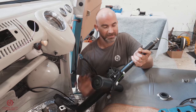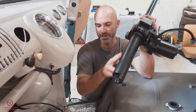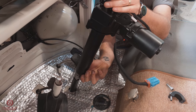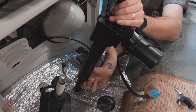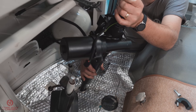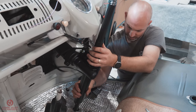And when it comes to you doing it, you'll do it in one fell swoop, I promise. So, first thing, make sure this thinner part of the collar is going over this curved part. Slot the whole shaft over this collar now. So that's over there. Before I then locate the splines into the collar, I'm going to spin the whole system round. And that woodruff key is now at 12 o'clock.